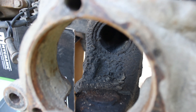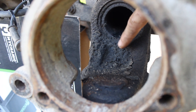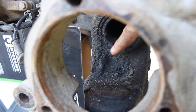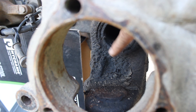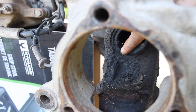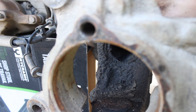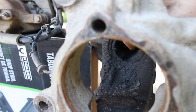This is what it looks like when your axle seal is leaking. You can see all the gross nasty diff fluid, a bunch of grease, and dirt built up here. So if you see wetness on the outside of your axle, your inner axle seal is probably shot. It's a lot easier than you may think — a lot of people get scared away because you have to take out the whole carrier and everything, but it's really simple.